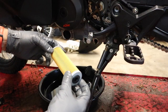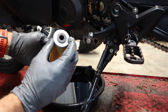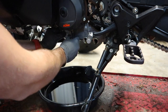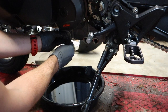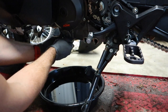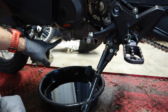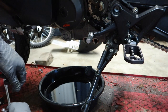Next up we're going to put our new oil filter in. It doesn't matter if you're using the high flow or the KTM one — there's going to be a rubber gasket on the back that goes inside the engine, and you'll feel it just kind of pop into place. Now take the oil filter cover with a little bit of oil on the O-ring on the back of it, and get this started by hand so it doesn't fall into the oil. Then we're going to tighten these down to just 6 Newton meters. Do not over-tighten — it's just aluminum, you don't want to strip anything out.